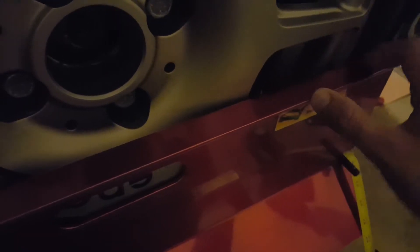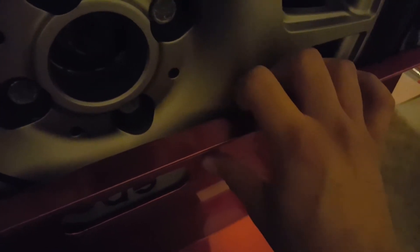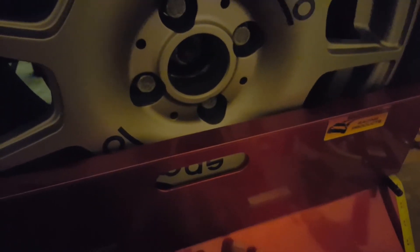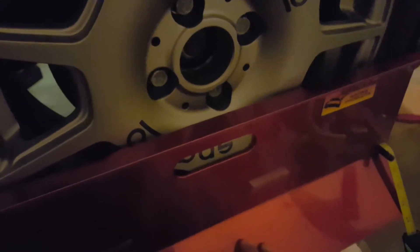They come in all different shapes and sizes. One thing to note: this particular model sits right against the bead of the tire, which takes a little accuracy away since tires aren't perfectly even side to side. That said, as an overall tool — especially for the track — if you go off or hit a curb, you can strap these on and get an overall measurement. As long as you're within a sixteenth of an inch, you know you're good. I wouldn't rely on these 100% for a full alignment, but I'm okay with them resting on the tire slightly.